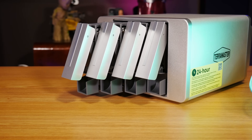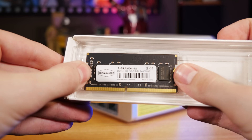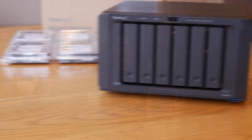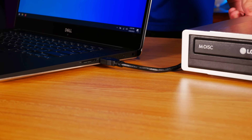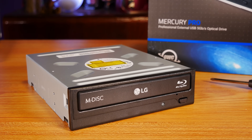For this guide I'm going to expect that you have some kind of a NAS with hard drives in it and you're probably going to want at least eight gigabytes of RAM for the most optimal experience. We really feel like Synology NASs are the way to go here since DSM makes this process trivial, but the guide should apply to the vast majority of NASs on the market like this Terramaster unit or even a random NAS from eBay. You're also going to need a Blu-ray drive that connects over USB. In our most recent guide we used this LG drive, which you can get on Amazon and just flash the firmware to enable support for MakeMKV's Libre drive mode — the software that allows the drive to rip 4K discs at full speed.